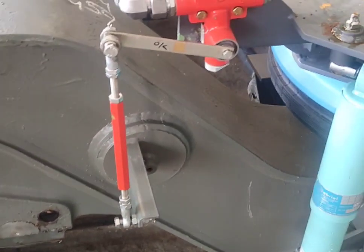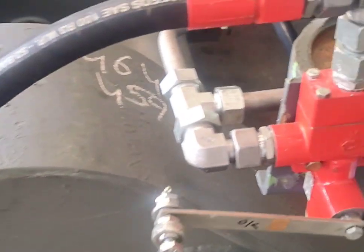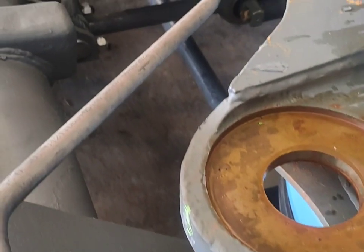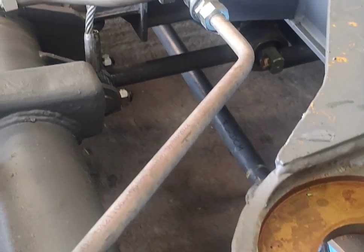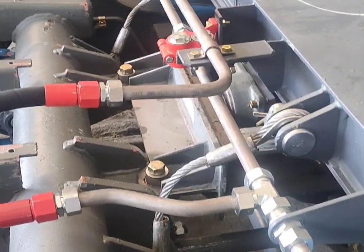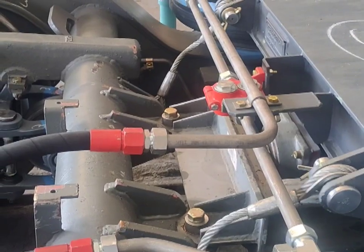You can see the connections — this is for the inlet, for the air supply. There is a pipe connection between the other leveling valve on either side, and in between there is a duplex valve. This is how it maintains the height.